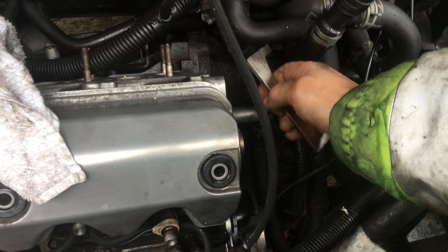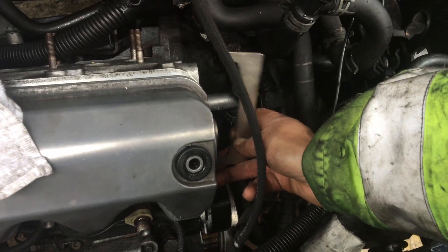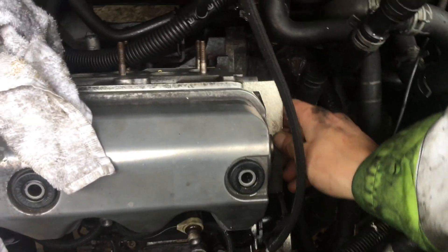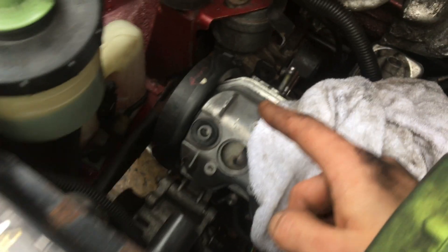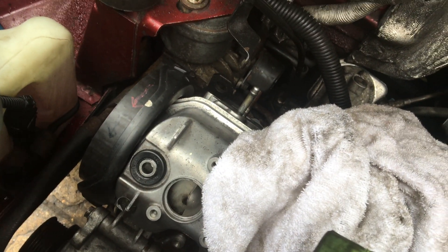The timing key does go in there. Just can't do it with the rocker cover there - let me see if I can get it on. There we go. So the timing on the block and the head are both still bang on. I'm going to torque this up and then rotate it a couple of times and then we'll check it.